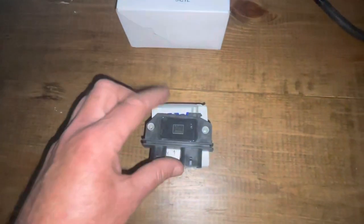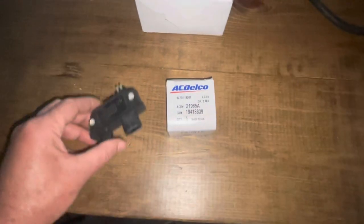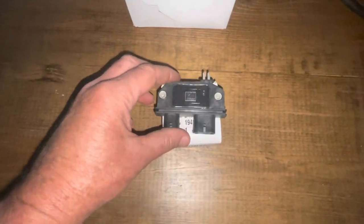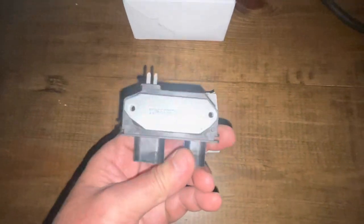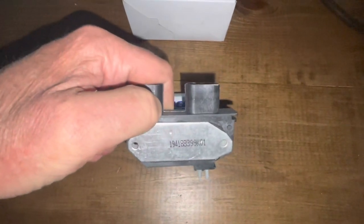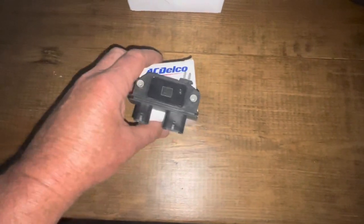This is the ignition module. It's a General Motors ignition module and the part number is D1965A. I will not sell or use any other module — I don't care who makes it or where it comes from. I will not buy it unless it's this module. You can tell the genuine GM module because it has the GM logo on the top and the part number on the back: 19418839. That's what's on the box right here. This module is the heart of the system and will make or break the installation.